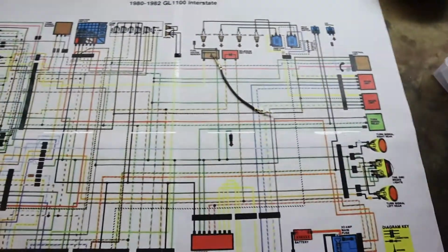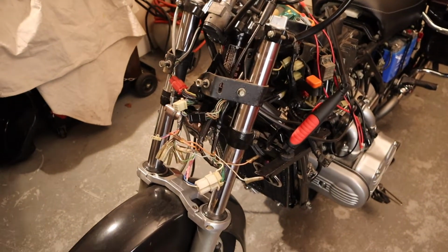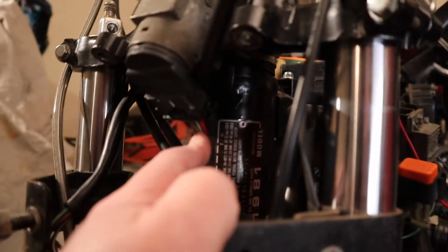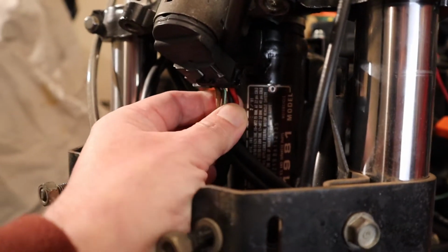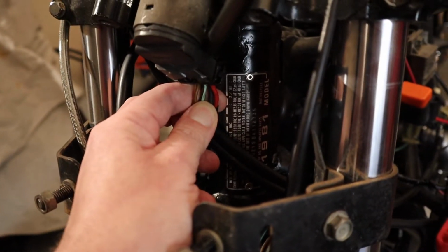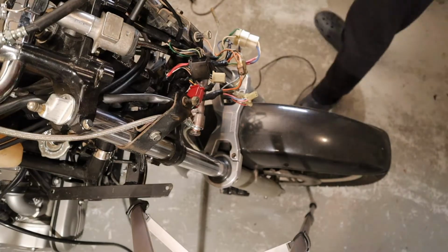Here we are by the noble steed. We have a treasure map, a device, so everything should be able to hook up using the connectors except for the 2 wires. We need to tap power and power under run condition here, basically on 2 turns of this. So we'll have to tap into red and black wires. Since we'll be dealing with live electricity, let me unhook the battery and get this in there.